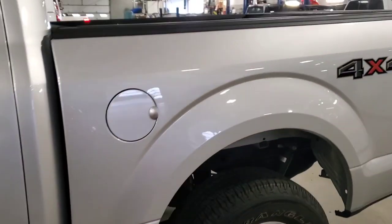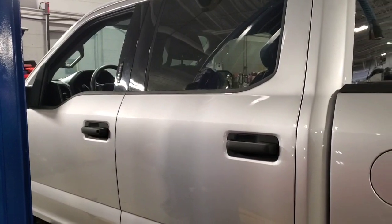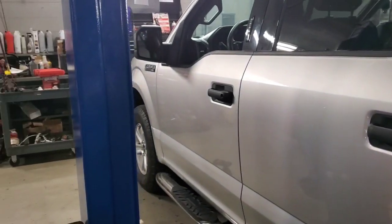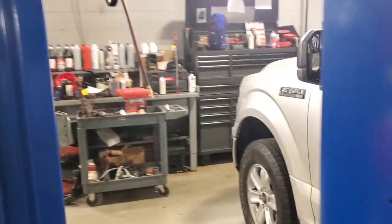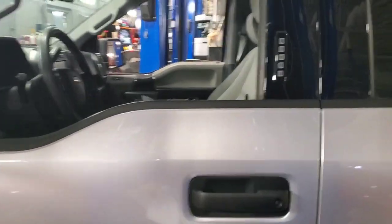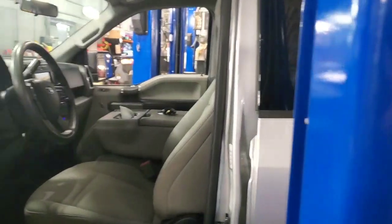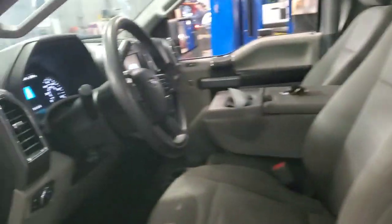We're working on a 2019 Ford F-150 with a 5.0 Coyote engine. The customer says every few days when he checks the oil it's getting low and he has to fill it back up. There's actually a TSB out that talks about during downshifting events when it starts shutting off fuel and bringing fuel back on to conserve fuel — basically part of the program built into this truck.